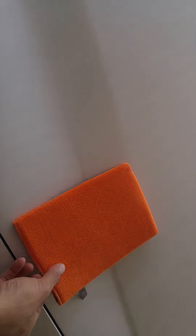I've sprayed a little bit of detailer on the prep mitt. You want to work in different panels — right now I'm doing the hood, then the left front quarter panel — so you know when you're done and don't scrub the same areas too many times. I've gone around twice because there's a lot of stuff on there. I normally keep my hand underneath so it doesn't fall on the floor. The mitt is pretty soaked — kind of like you're drying it.